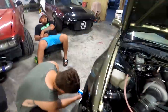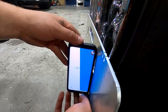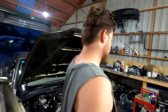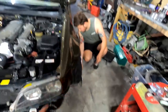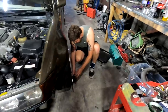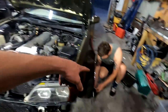Gazza's checking my camber. Ideally I want about 6 degrees. Five-eight. Check the other side. This is probably not the most accurate way of doing it, but it gives you a relative idea. Because I just done a quick eye alignment. One side's got more — four-point-eight. I might try and match that side to that one, like a whole degree out.